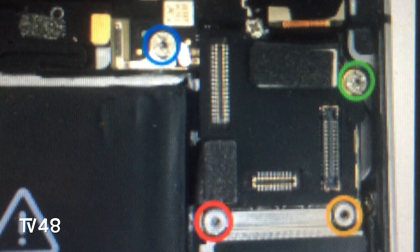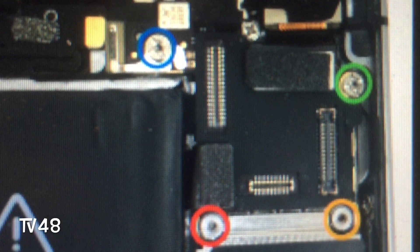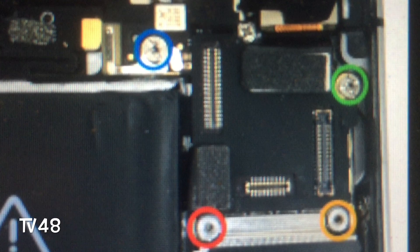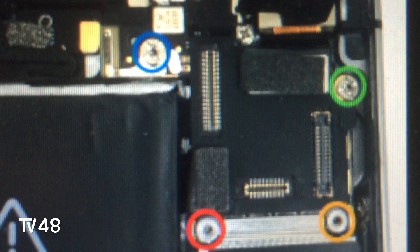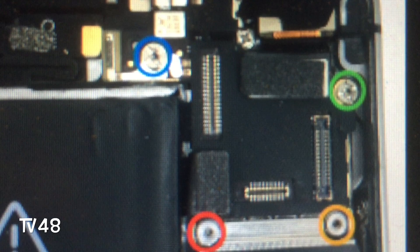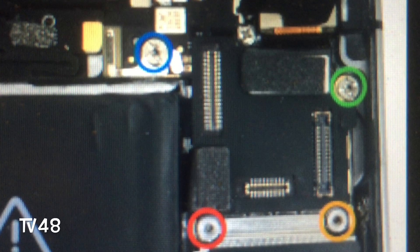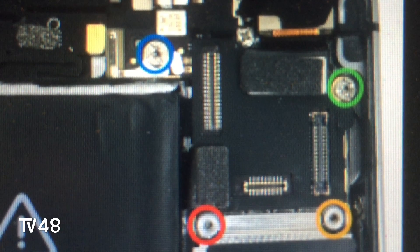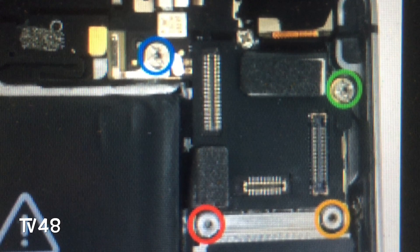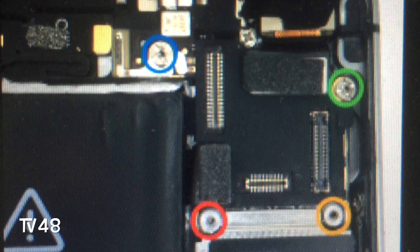Don't close the LCD yet — turn the phone on and see if it starts up under 30 seconds. If it starts up under 30 seconds and you don't get the blue screen, then you've fixed your phone. Go back into the phone, remove the battery once more because you don't want to make any mistakes, then put back the cover leaving the yellow screw out — just tighten it up with the three screws, and don't tighten them too hard, just snug. Then close your phone again, connect your battery, connect your fingerprint cable, close your LCD, tighten up the two screws underneath, and you've just fixed your iPhone 5s.